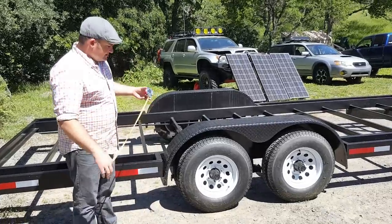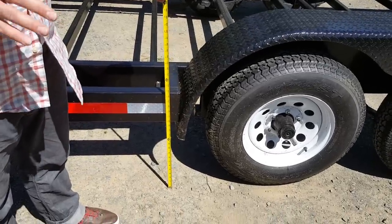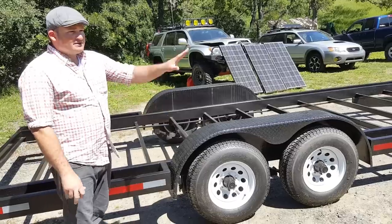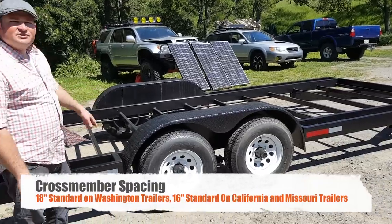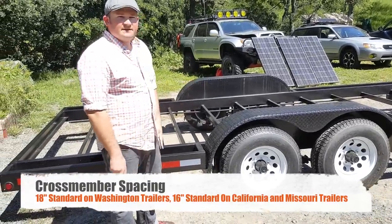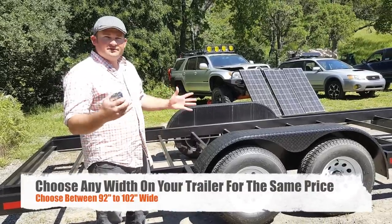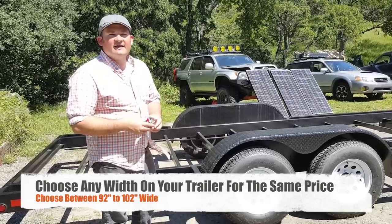You can see the height of this trailer is just about 21 inches — they tend to range about 21 to 22 inches for drop axles on any of our tiny house trailers. This one is pretty much identical to the California trailer, but this one has box tube framing and that one has C-channel. It's a little more narrow at 99 inches wide so that when the finished exterior siding and trim are placed on, the full house will be a full 102 inches — or eight and a half feet — wide.